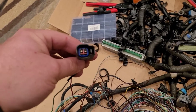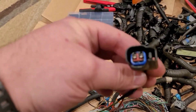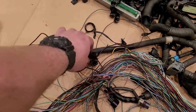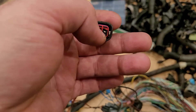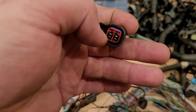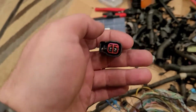Here you can see one that I tried to take apart and amazingly failed on. This red cap is like a locking ring — basically you have to get that locking ring off, and then there are little clips in here that hold the pins in. So if you want to de-pin this connector, you've got to get this off.